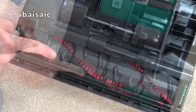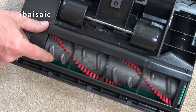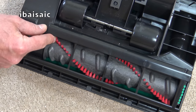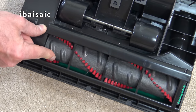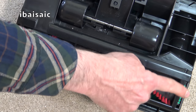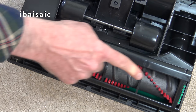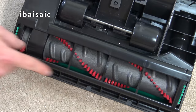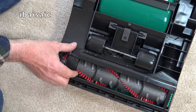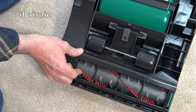It's still got the agitator, or activator brush roll, should I say, first shown on the original Turbo Power, but later versions of this did away with the beater pads, and it was just a spiral brush with fixed brushes. And again, I don't think the Enigma, the model you can buy now, even has side brushes. I've shown an earlier Enigma on my channel.